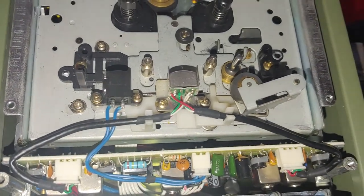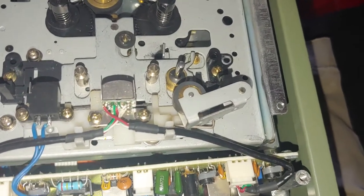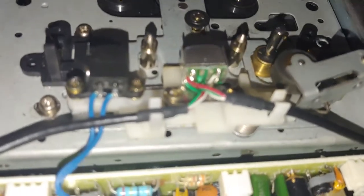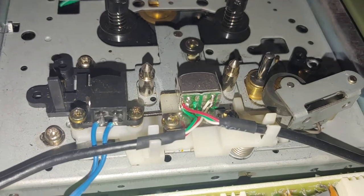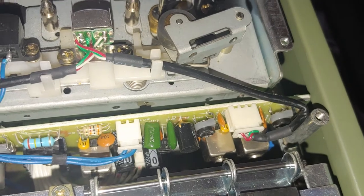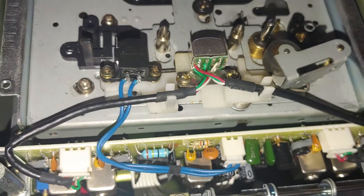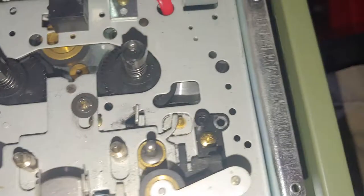That one's the copy side. Since it does both sides of the cassette at the same time, you need twice the wires on the copy head. There's the wires for one side of the tape and then the other side of the tape, and then there's your electromagnetic erase. It is just shoved packed with so much stuff.